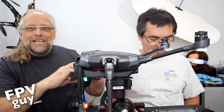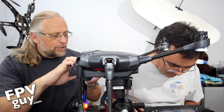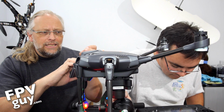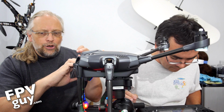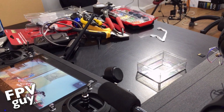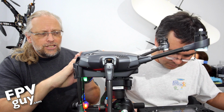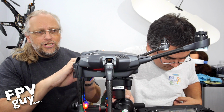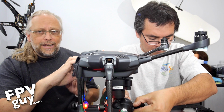Ideally, you could focus this by taking video out from the controller and putting it on a 1080p TV. However, what we're doing right now is we are simply going to where it feels sharp, and then we are moving past it and finding the softness or unsharpness on both sides of the sharp. That way we know it needs to turn about halfway back between those 2 points to be in the sharp position. If you really want to tweak this carefully, you take some JPEGs, move it a little bit, look at your laptop and repeat until you find the position that has the highest sharpness. And that's of course what we're going to be doing a little later to fine tune this install.